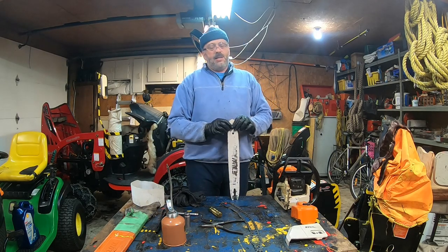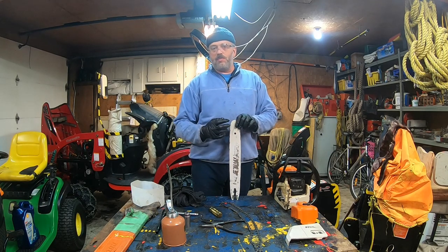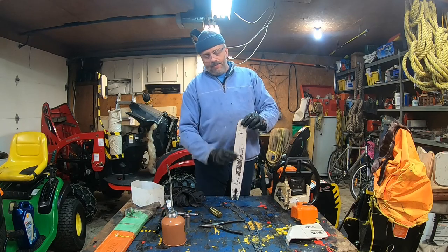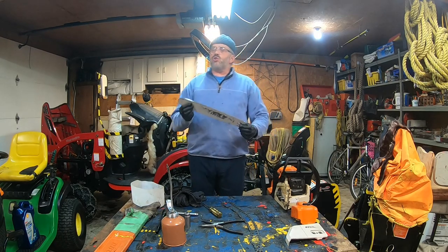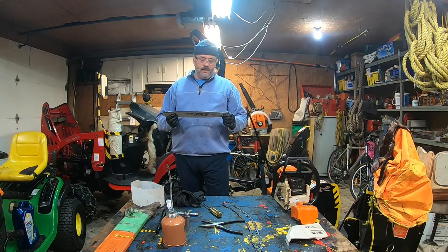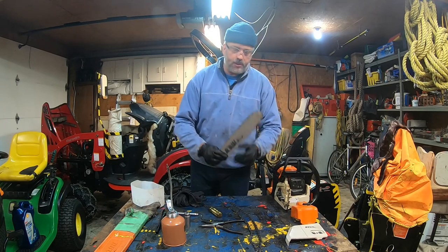Usually bars don't rust, but I had some rusting because I was living in the maritime. It's very humid, the sea salt and everything, and also cold storage with poor ventilation. Having a nice coat of oil will keep your bar in good shape. And also it helps to lubricate because at the beginning, if it's in the winter time, your chain and bar get exposed to various things.